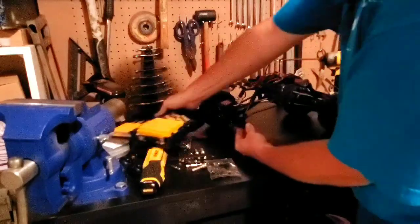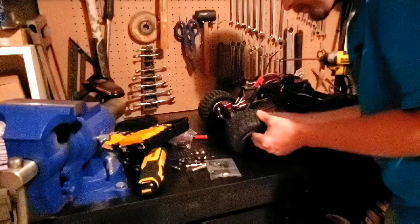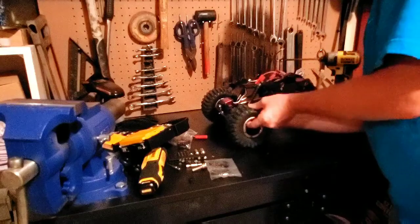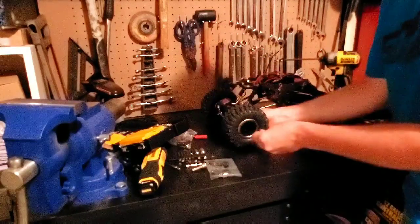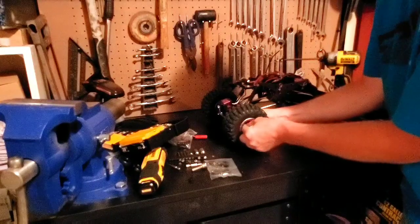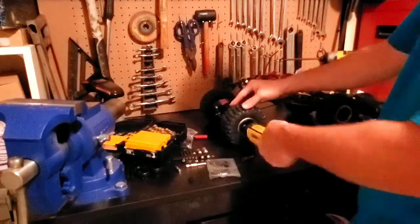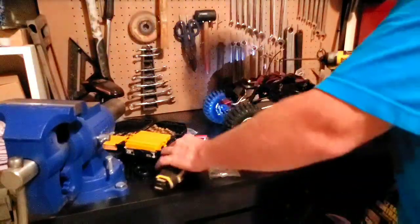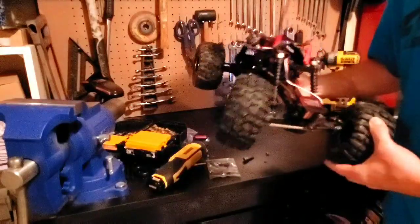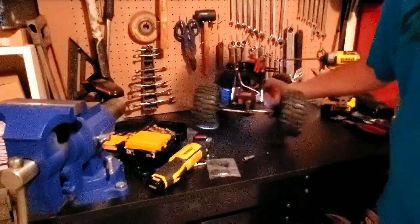Now you'll put your wheel spacer back on. Take and put your wheel on, which is very, very easy to put on now. It's a little different because you don't have the stud sticking out, but you can see the hex to line it up. So, kind of a double-edged sword. Now you need to tighten it down. Remember, you're dealing with plastic, so you don't want to over-torque it, but do not leave it loose. If you over-torque it, you could maybe by chance bust the actual nut itself, and if you tear that nut up, you would probably have to buy a whole new wheel spacer kit to replace it.